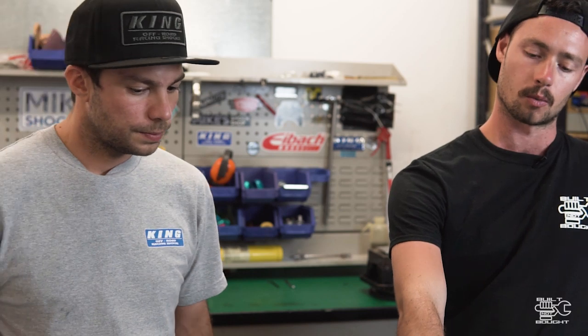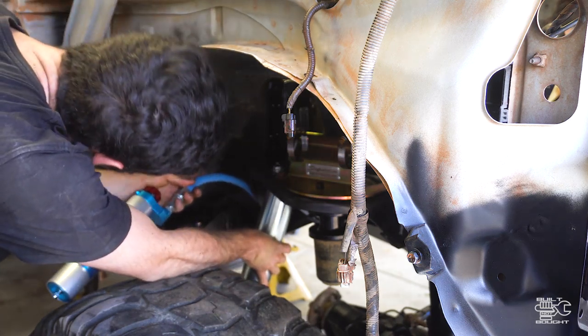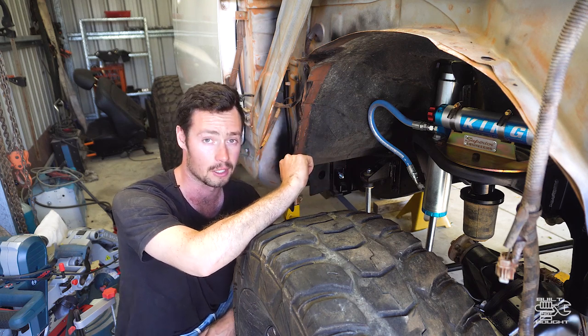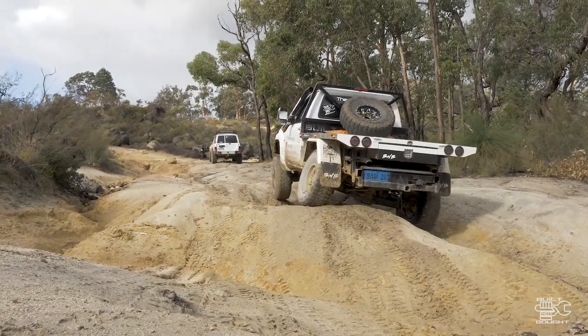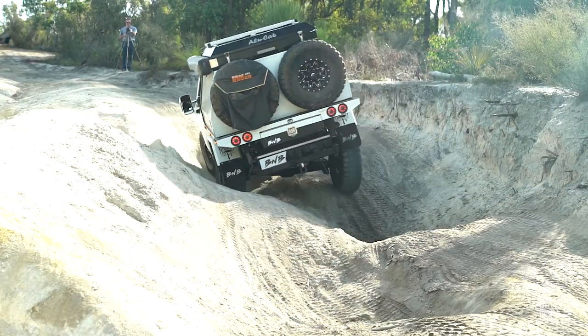The red knob is attached up here - it just screws in a valve and allows oil to either, when it's fully open, bypass the shims both ways. When it's closed somewhat or all the way, it'll start to force oil through these shims. Those shims are also interchangeable to make your compression adjuster more aggressive. For road-going four-wheel drives and tourers - guys who tow a trailer during the week and then throw a swag and esky on the weekend - we can valve the compression quite soft on the main piston. It allows for when you're unloaded or just cruising to have a nice comfortable feeling, and then you can crank it up when you need to. I recommend them on anything that does more than one thing.